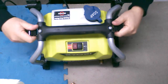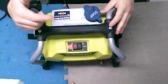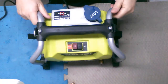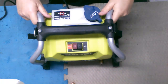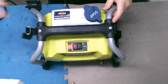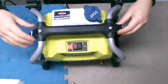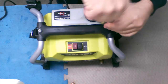Now I already tried the obvious. I thought maybe it had an air bubble that was preventing the motor from spinning up. So I hooked it up to the hose, ran some water through it — went in just fine, went out just fine. So no air bubble inside the system. Tried rocking the switch a few times, nothing happening. So either it's not getting power to the switch or not getting power to the motor. Let's open this baby up and see what we've got to work with.